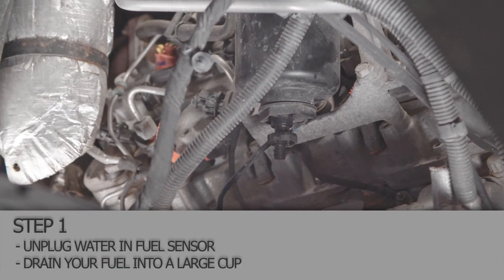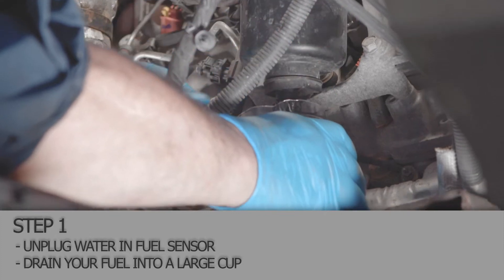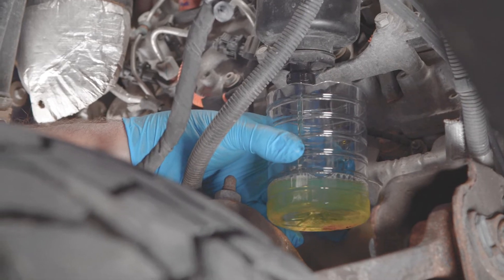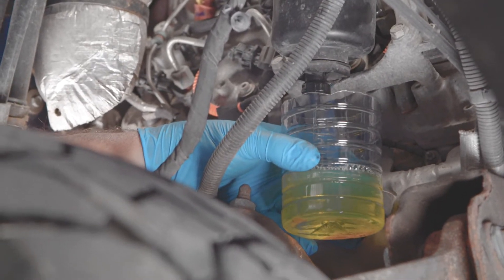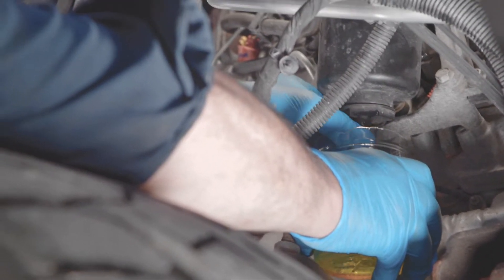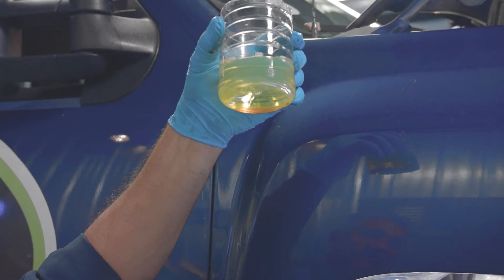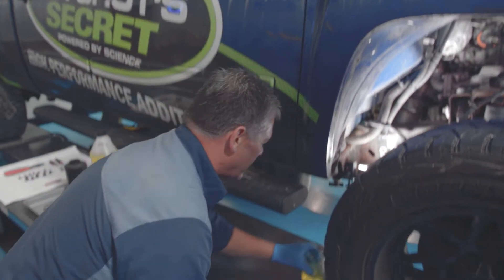So if you ever get water in your fuel, you want to bring a little cup in here and open this drain and let fuel come out of it. Since we're going to go ahead and change the fuel filter, I'm going to drain out as much as I can to keep it from making such a mess. And this one does have some water in it. You can see on the bottom right in that area — that's not enough to turn the light on in your dash, but that's what will kill your injectors if you run a lot of water through it.